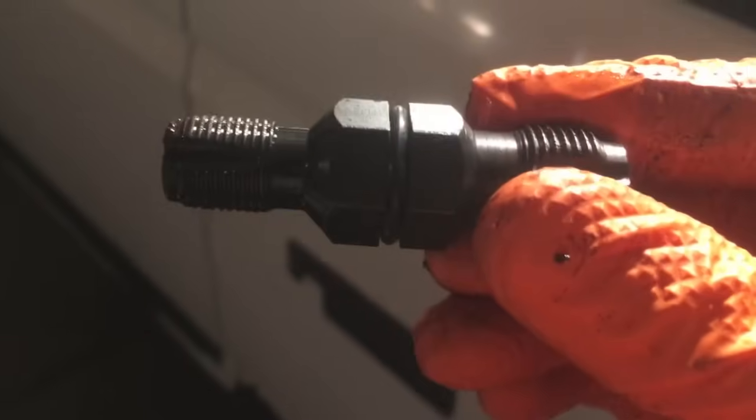Next thing is to take a spark plug thread chaser. This one's made by Lisle, grabbed it at O'Reilly's — it's double-sided, 14 millimeters on one side and 18 millimeters on the other. We're using the 14mm side. I've oiled the extractor hole and the plug hole. I'll gently come in here and clean up the threads as best I can. On the other plug I didn't even need a socket to run it in or out — the threads were actually pretty clean. It was the chamfer right at the end of the plug that was causing all the problems. It bottomed out just like it should.